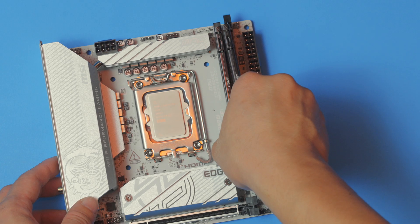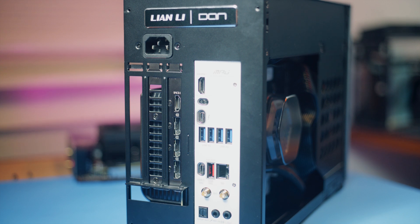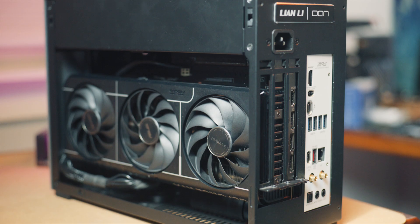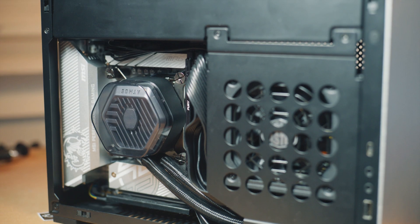As configured when I did my price research, it came in at about $1,760 US, and that is budgeting a whopping $200 for a 32-gig kit of DDR5 5600. If you're building now, I hope you can get it for cheaper — not too long ago a kit like that was $100, so this is not great right now. That would be my one hesitation: the price of DDR5 right now. But yeah, that's the state of the world. This is an updated mid-range A4 H2O build, and it's a very scalable build too — I would have no qualms about running a hotter CPU in here. On AM5, if you wanted to go with a B850i and a 9900X or 9950X, you could run a 5080 in here no sweat. At the same time, if you're only running a 5060 or older-gen GPU, it's still not out of place — this case doesn't demand a high-end GPU. It's a really versatile case. I hope you enjoyed it; make sure you are subscribed, please give a like, links are down below, and big thanks for watching today.